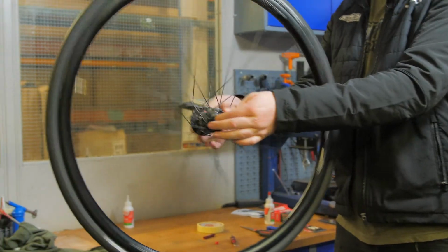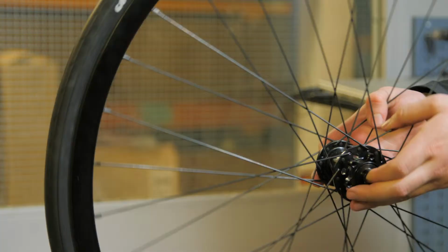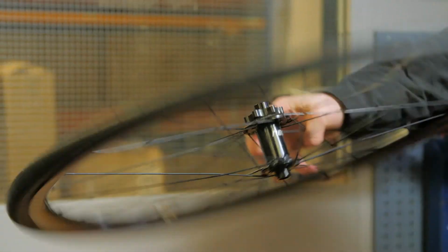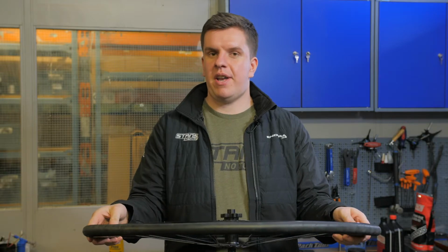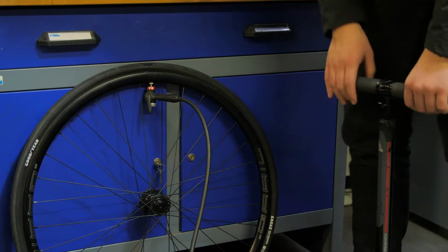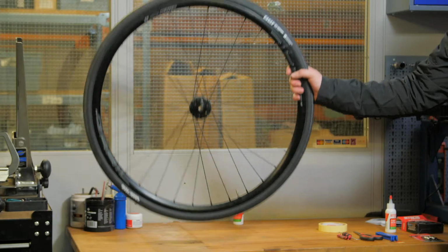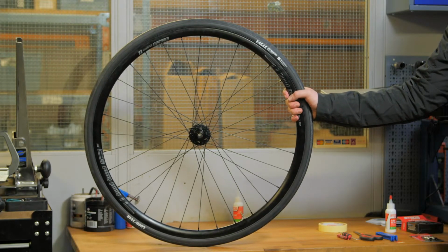Now you've got sealant in the tyre, spin the wheel to circulate the sealant, then re-inflate. Another tip, if your tyres are leaking sealant through the sidewalls, is to lie your tyres side down for about half an hour on either side to fill those small gaps. Now your tyres are set up, reinstall them on your bike, leave them overnight to make sure the setup's worked okay.